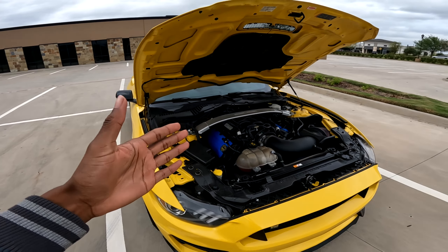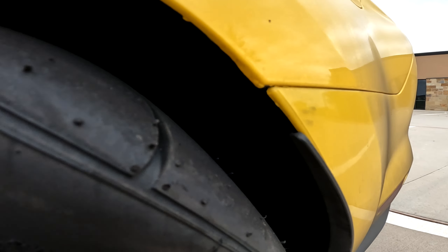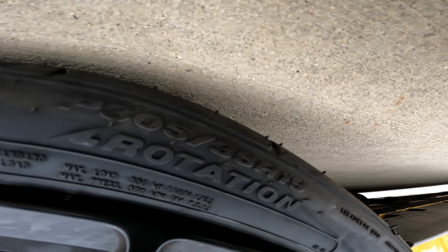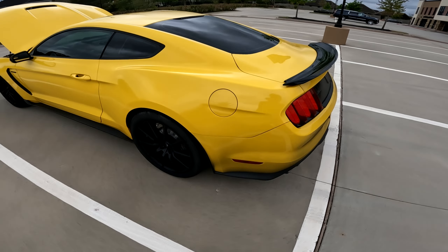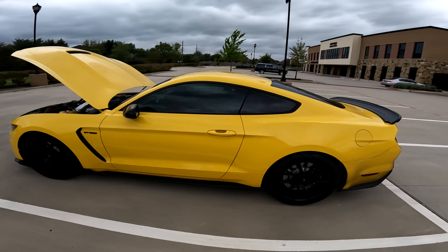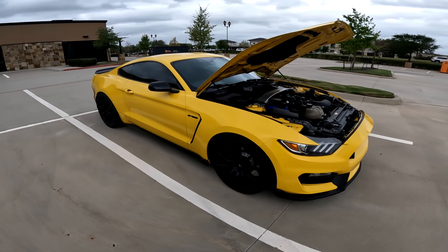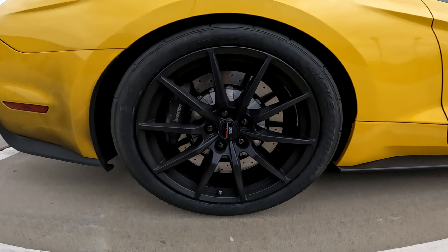If you're looking to modify your GT350, go ahead and do these modifications: headers, E85, JLT, tires, and a clutch — you'd be good to go as far as NA goes. For those wondering about the fitment with the Mickey Thompson ET Street SS tires, absolutely no rubbing — stock sizing, 305/35/19s. It looks pretty aggressive, the only thing to worry about is the rear bumper getting dirty since it is technically a radial, but this car hooks and books and it is nasty.